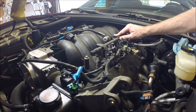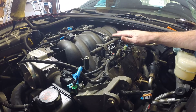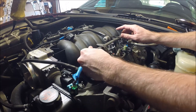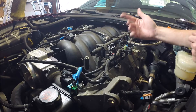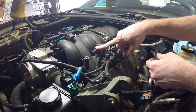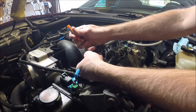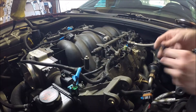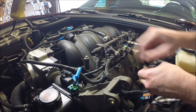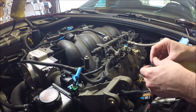Another tip: obviously before you pull the fuel rail off or disconnect the fuel line coming in here, you want to release any fuel pressure that's still in the fuel rail. There are a couple ways to do that. You could pull the fuel pump fuse or relay and then crank the motor over and that'll run it out of fuel. The other way: grab a towel and on the end of this fuel rail there's a Schrader valve. Just get a towel to cover the end and then tap it with a small screwdriver. Be careful - it could be under pressure if you've recently driven the car. In my case it's been sitting for several months so most of the fuel pressure was gone anyway. This just releases any fuel pressure so when you start taking lines off, it minimizes how much fuel leaks out and you don't get sprayed. Just be careful.